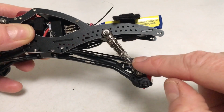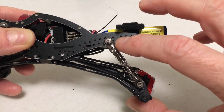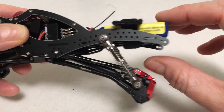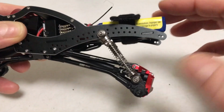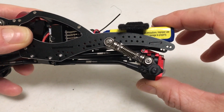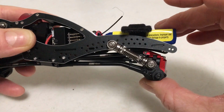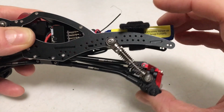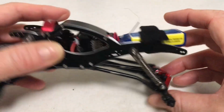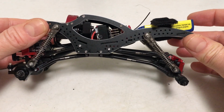And then for this shock, like I was saying earlier, I was hitting that tray. So if I moved it back one, it stopped it short, but stopping it short may work out perfect now with that bulk of the Velcro. So now it's hitting the Velcro, and you can see there's some piston left. So I could leave it as is. It's got a soft bump stop now at least. Or I could move it back and keep it maybe from hitting that. But overall, super happy with how clean that worked out.